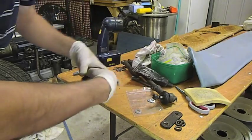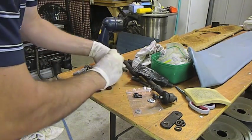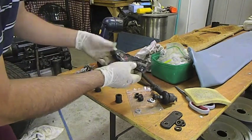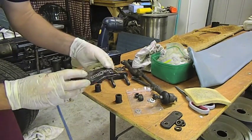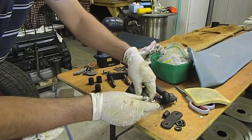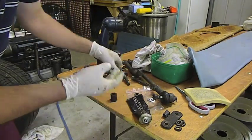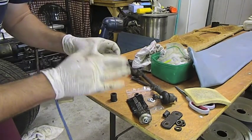These shackle bushes can be really tight to put on - they're for the rear. Let's take these nuts off. A good idea: make sure you clean up all the surfaces that the bushes are going to slide onto. With brakes, whether it be wheel cylinders, masters, or anything like that you're playing with, the rubber grease you get is the PBR stuff. It's proper brake stuff. But you can also use a very light smear - it sort of feels like runny jam. You don't want too much of it because you don't want the bush sliding around too much. It just helps you get it on.